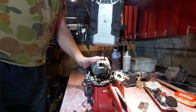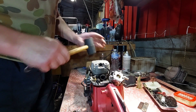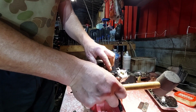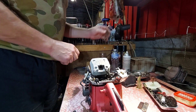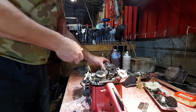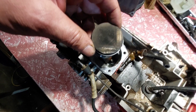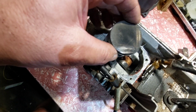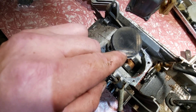Let's see what the tattooed pistons do. Tap it, give it a tap with the rubber mallet. Watch the carby - I like to leave the carby on because the needle and seat holds the fuel in the line. If you take the carby off it makes petrol come out all the time and it stinks. There you go - the cylinder's coming off. There's the tattooed piston. I would like to run more time on this, but it seems to work. I spent more time on the grooves going on the very edges. Not tattooed as much as I do with the 62cc, but there's a tattoo there - one, two, three - three of them.